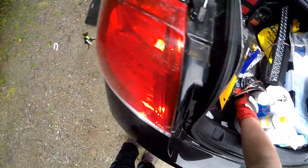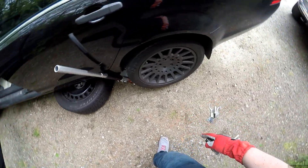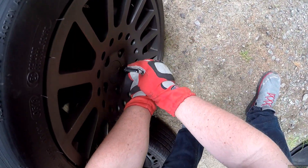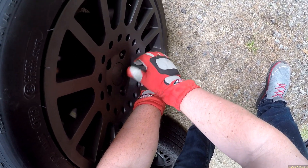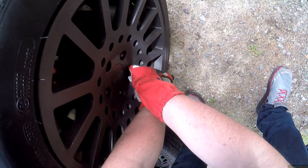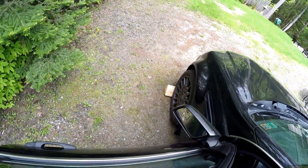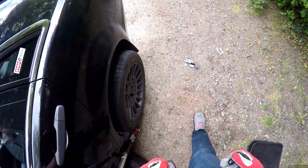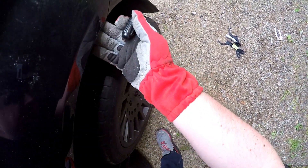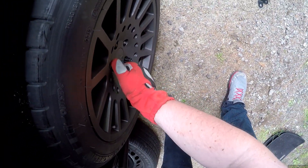I don't think you actually have to watch me put this back together, but if I show you this side I don't have to show you the other side. Just get one on there to hold it — push the bottom. These lug nuts stick out too far. The front ones are flush because the offset's different. I got the wider offset but we guessed, and that's why I'm getting this rubbing right here. We had to fold the fender here, but we can't do it where it meets the plastic.